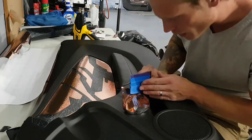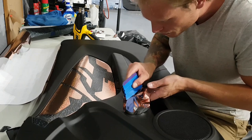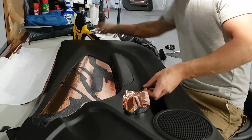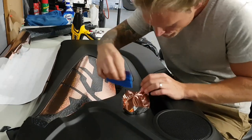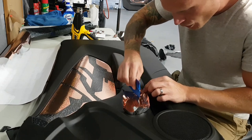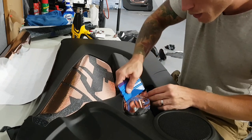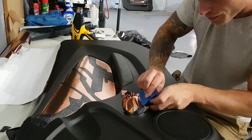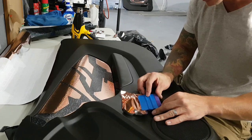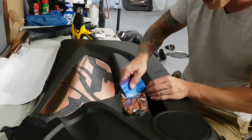So I'm going to add a little more heat there. Now I'm going to start squeezing this down around the corner very gently. So now I can feel the squeegee go underneath the handle, which means I know that I'm beyond the edge where I need to be. There's an edge right here and I can tuck the film actually underneath it, so if I roll my squeegee around underneath that corner, I know that I'm all the way through — so we're good.